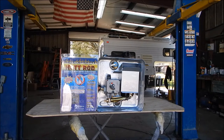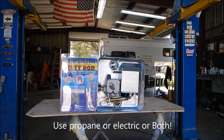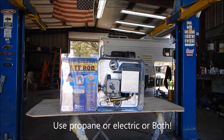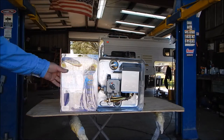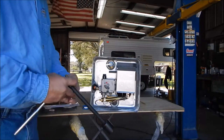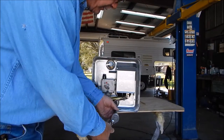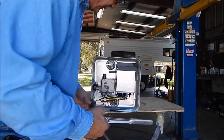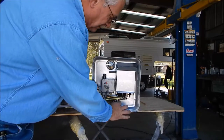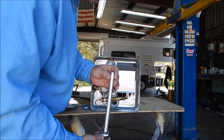I'm going to show the Hot Rod AC water heater — a conversion kit for your LP tank. This is my brand new six-gallon Suburban tank I just bought. You're going to need a one and one-sixteenth inch socket and a ratchet to loosen this anode, which I've pre-loosened. You remove that — that's what it looks like, it's sacrificial metal, like aluminum.